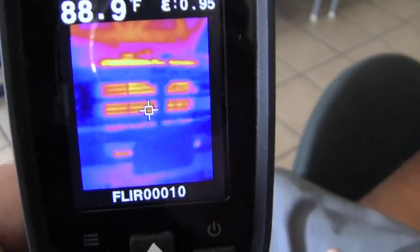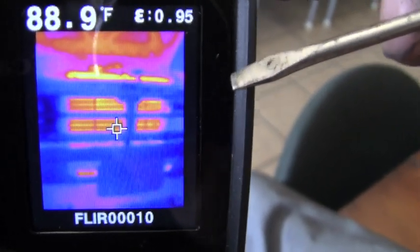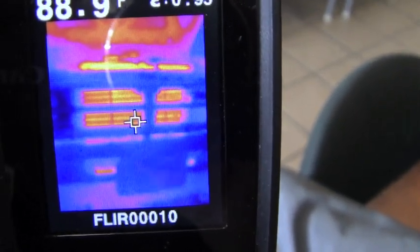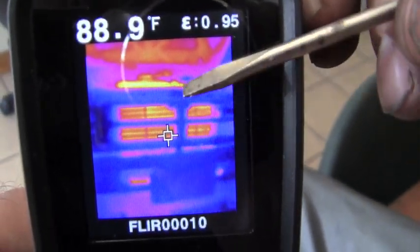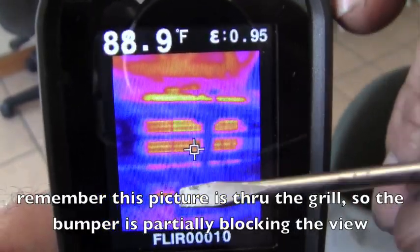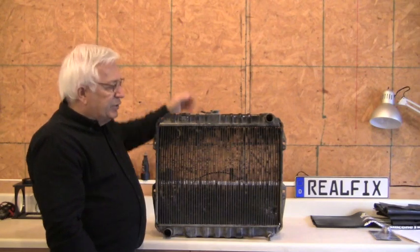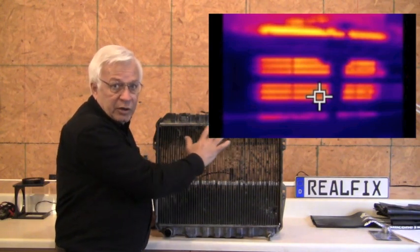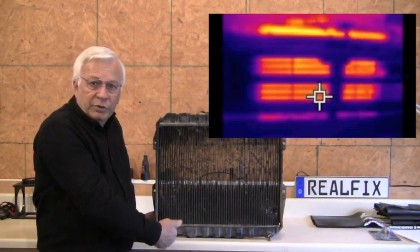After condemning the radiator and getting approval, we replaced it — and the overheating concern is no longer present. The top tank temperature still averages about 150 to 160 degrees, but now the temperature changes all the way across, and even the bottom tank is just barely warm. You can clearly see the heat drop from the top tank to the bottom. In the new image, the tank is hot, all the channels going down have exchanged heat, they get cooler as they drop, and cooler coolant returns to the engine for more heat exchange.